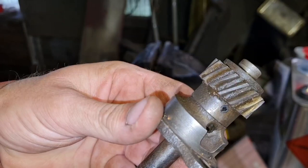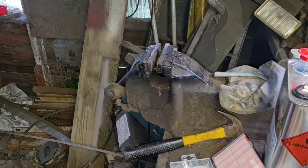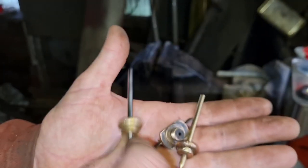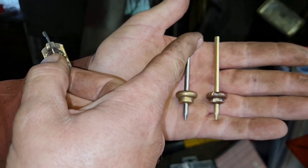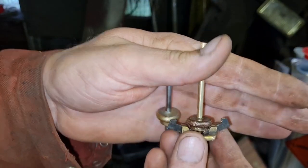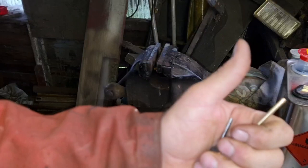That's the end of this video guys. Hope you enjoyed our little putting the thing back on the shaft and fixing that, and making that new carb needle - which was totally gone. The old carb needle had totally disintegrated; I didn't even have an old one as a pattern and had to borrow this one out of my PB8. We made this one to match it, and yeah it seems to be right. It's a tiny bit too long - I'd rather it too long than too short; I can always grind the end off. One last look at that - man cave done for the day. Thanks for watching guys, see you next time, bye for now.